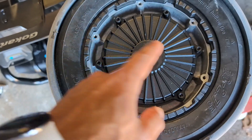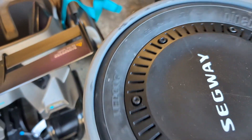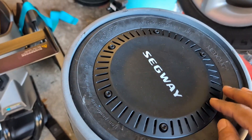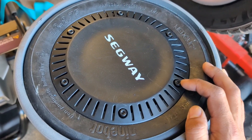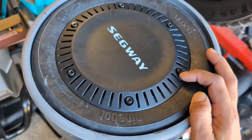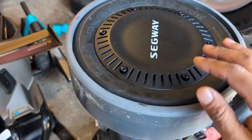The wheel is on there and it spins without interference — that's a good sign. The way I ended up doing it: I hammered down until pretty close, then installed the cover and put the screws in, using a star pattern to draw the wheel the rest of the way on. One warning though — these are really small screws and I don't think they're super high-grade. If you're doing that method and running into a lot of resistance, don't crank on them or you'll break the bolts or strip the threads. I just went until I felt a little resistance, then moved to the next one. The wheel is on there flush and spinning true.